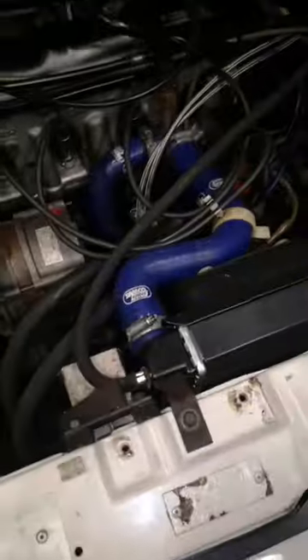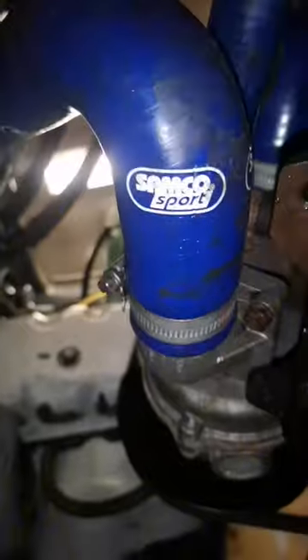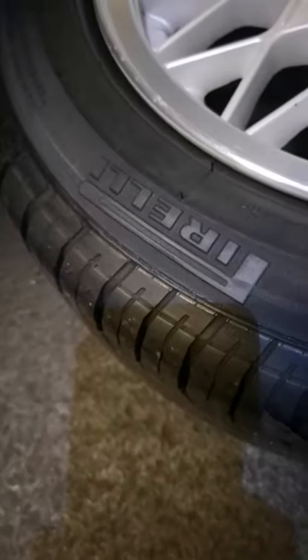We'll check it for leaks. We can't find any dripping now, so we can assume that's sorted. But there is a little bit of a gearbox leak — we'll sort that later. Now we turn our attention to the rear, where it was making some rubbing and creaking noises. As you can see, there's rubber on the arch lip here — it looks like the previous owner didn't cut this back, and there are signs of the tyre being rubbed. So I guess we can sort this one out as well.